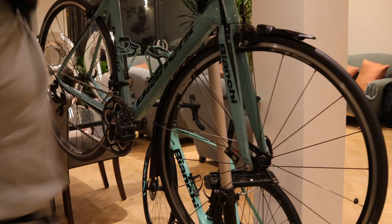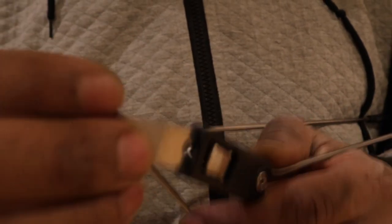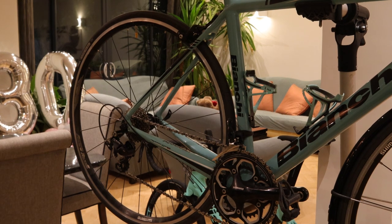This was a first go — I've just put them on and didn't really have to make any adjustments. I spun it around to see if anything was rubbing and there was no rubbing. So I proceeded to do the rear mudguard and the rear brake pad change as well. Here I'm just showing you the clips — they just push in, simply slotting in, and once you push them in they click into place. Once you hear that click, you're good to go. These are the easiest mudguards to install — you don't need to be a bike mechanic. I'm not a bike mechanic, I've got no training whatsoever. It's all trial and error; I'm learning as I go.